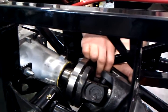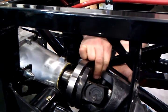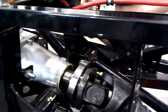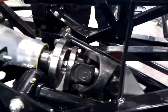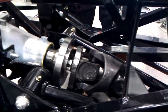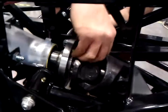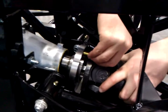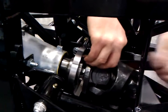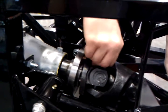I'm going to push it all the way through. If you need to, you can push the drive shaft back into its plunge a little bit to see the bolt. You can slide the drive shaft flange back from the drive flange so the bolt is exposed — that might make it slightly easier to see where you're putting it in the hole. I'm just down here assisting, pushing up the U-joint and moving it around to make it clear.